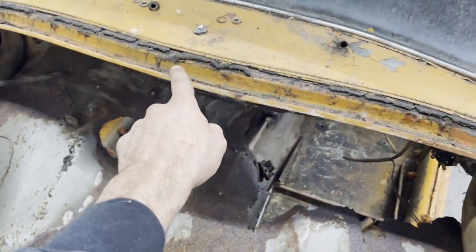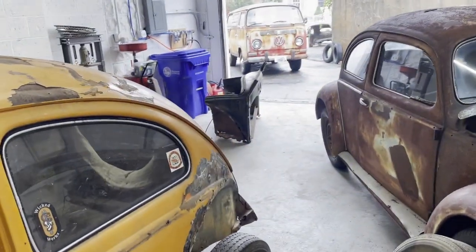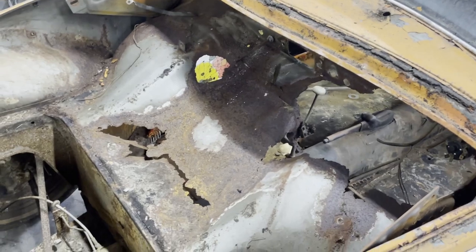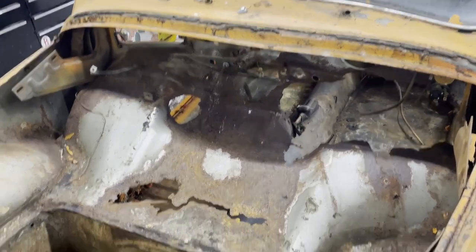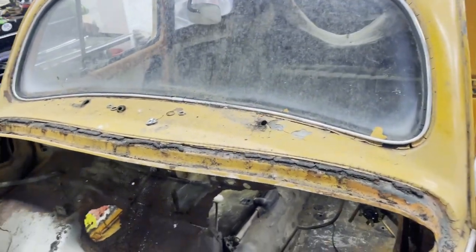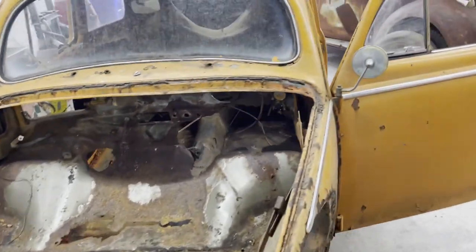Column's out. I was looking at this some more and I noticed the crunching here in the corners. So I measured from here to the furthest out point of the cowl on this compared to my clip, and this distance on my car is about a quarter of an inch narrower. I'm willing to bet it's just because the whole car is pushed back. I'm hoping that's negligible. Next step is glass — I'm gonna cut that out of there and see how that channel looks, and then figure out how exactly to get this out in one unit.